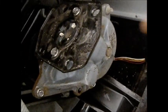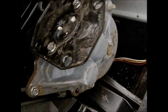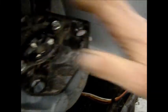So we just put this other one in and we should be good. I had to lay it all the way down because I had to shove it in. Occasionally these things will be hard to pull out or push in — this one was hard so I had to lay it down. Next I need to put the motor back in and make sure the drive coupler is lined up.